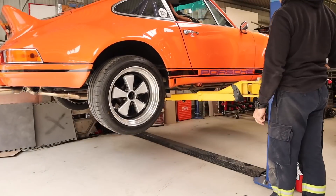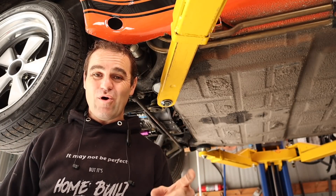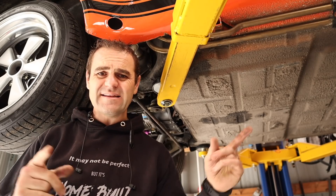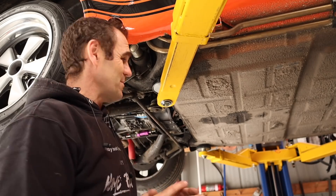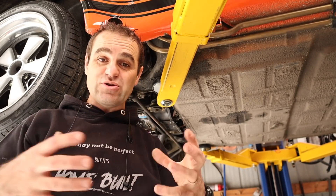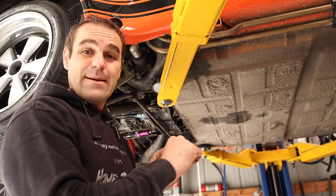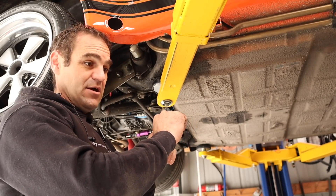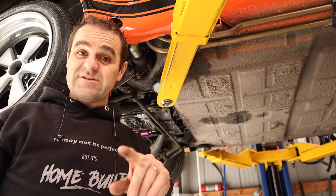Because Harry has been sitting in the garage for a while, I noticed something worrying — a small patch of oil on the ground. But instead of coming from the engine at the back, it was coming from the middle of the car. I was very concerned I'd have to pull the engine out and deal with the front of the gearbox — the nose — which I'd removed earlier. This is a cable-driven speedo in this early 915 gearbox, and the drive had fallen back into the case and everything was leaking. That has not been the problem though; that seems to be holding.